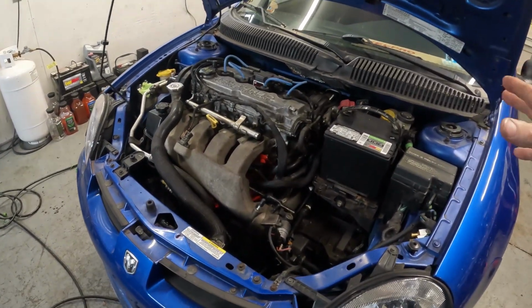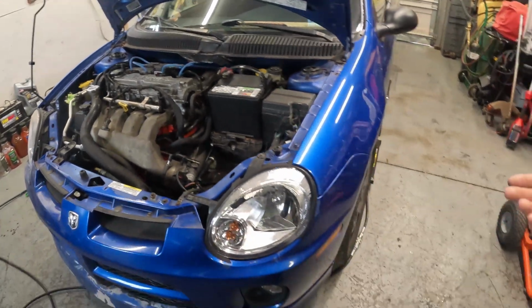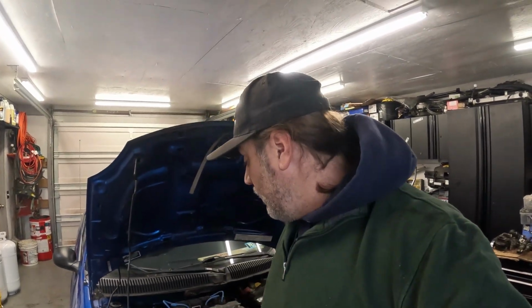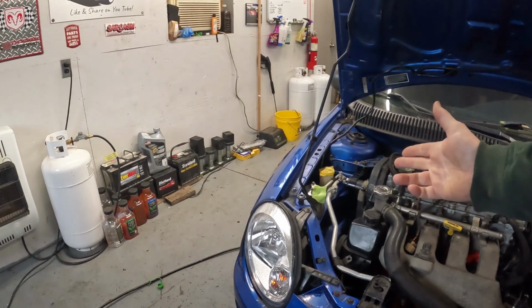I started this thing, but I didn't let it run long. But hey, I didn't see anything on the floor. We'll know more, obviously, because I did pull it in here, when we get it up. And we're just going to finish this thing. We're going to get it started. We're going to bring it up to temp like we do any other time. Get all of our coolant in, double check all our fluids. Run this thing through the gears up on the lift. Just give it a good once over and a little quick putt back and forth down the road. And hopefully it'll be good from there. We're going to have to charge our air conditioning.